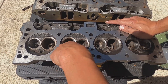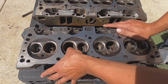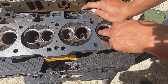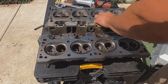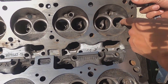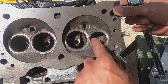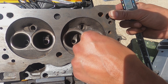We're trying to reduce the angles there - I could probably do a little bit more milling to take more of that step away. The other thing is we just want to open up as much as we feel comfortable doing without hitting the seat. You can kind of see the shinier part of the seat, and then there's a lot of material on the insides - we don't need that. We want to just open it up to be wider at the neck.